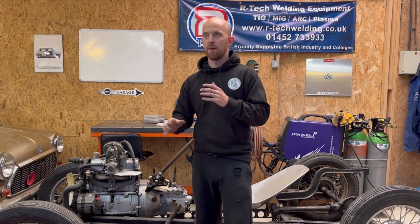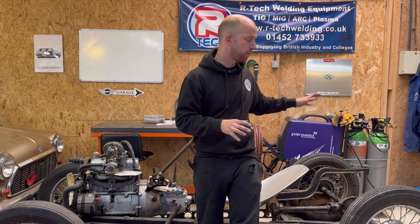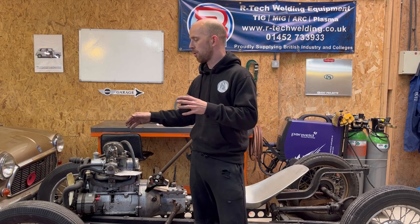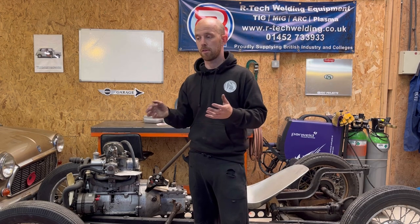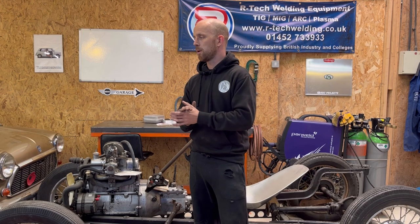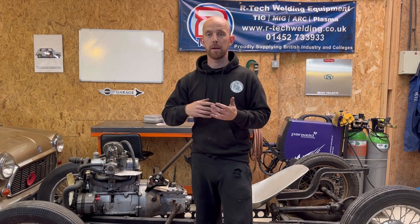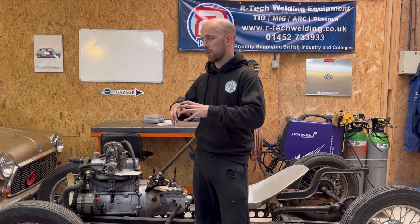I reckon maybe in the next episode, once I've got everything at the right height, I'll replicate the fuel tank and everything at the back, and the weight, to get it to the right height. I'll then probably order the material for the wire buck that I'm going to be making, and mock up a nice frame that I'll be making the body over. Again, I'll show you all these processes: how I go about making a body, the wheeling and the welding, and just basically the construction of a body.